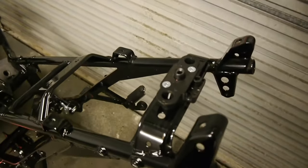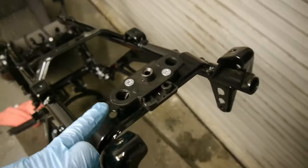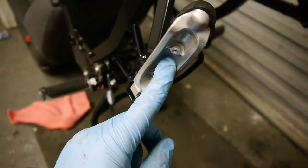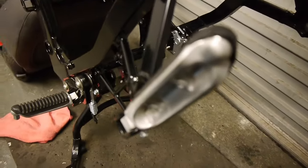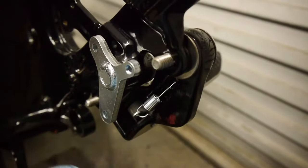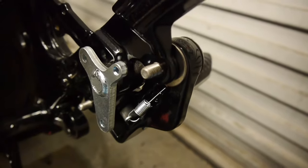In between episodes we've got a few small things done, as you've probably seen from my How to Restore Aluminium video. This little seat catch was put on but it wasn't recorded — nothing major — but I did go over how to clean and prepare these little foot pegs to stop the aluminium corroding again. A little tip: clean them down with a scotch-brite and put a bit of lacquer on them. It stops aluminium corroding. Some new stainless steel bolts and washers for the foot pegs. As you can see from the back, the springs are nicely zinc plated and this little rear brake pivot point is nicely zinc plated.